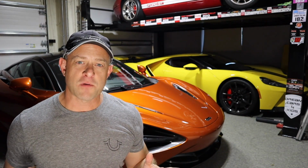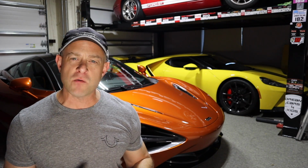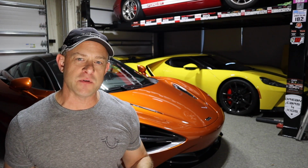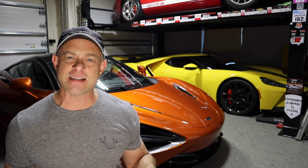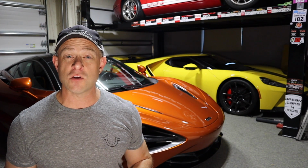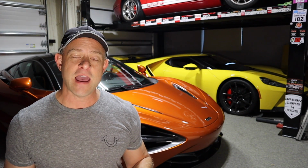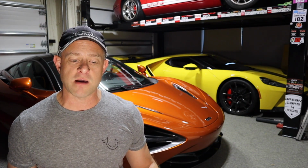As to the Taycan's performance throughout the day, roughly 2% came off the battery for every run. We weren't running back to back. We were looking at the data in between runs, but we made 5, 6, 7 passes. Ran the battery down into the 80s, and there was no performance degradation down there. The car was still running 10.5s at over 129 miles an hour.